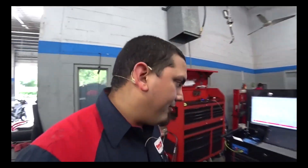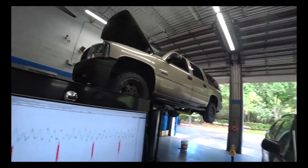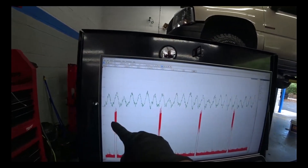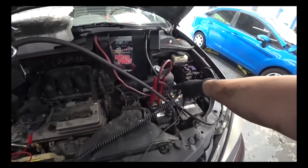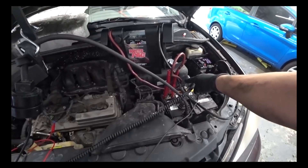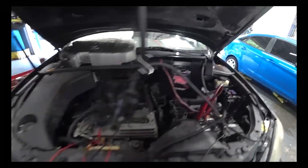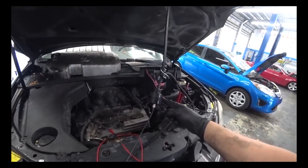I had seen this — see that low compression there. We are synced to number two right here — number two coil. I've got my amp clamp on the positive side, my injector fuse is pulled right there, and the jumper just in case. And this is a pressure pulse sensor.